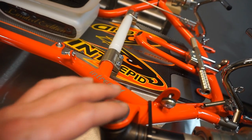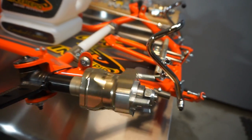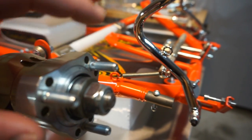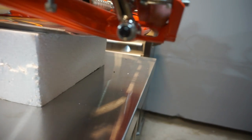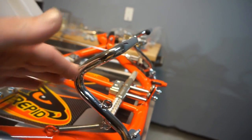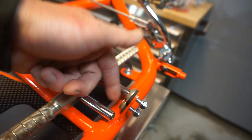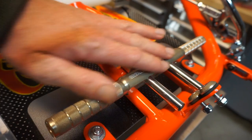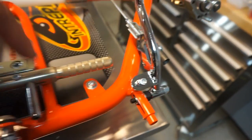It comes from the box with zero camber pills but includes a set of 12-position top and 12-position bottom camber/caster adjusters. The 75mm front hubs are on really smooth bearings and they machine the centering pin for the wheels out of aluminum — most have a plastic insert. The pedals have an adjustment track that slides forward and back about an inch and a half and can also be angled up. Here you can see the steering fairing mount — the two mounts keep it dead center rather than pivoting over by your feet. There's also an adjustable, knurled heel stop that can be flipped around for shorter drivers, plus throttle stops and brake stops. Really nice machine work on this kart.